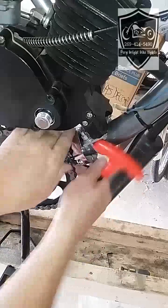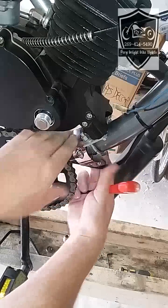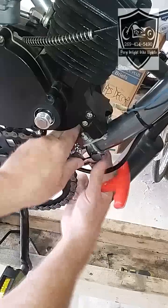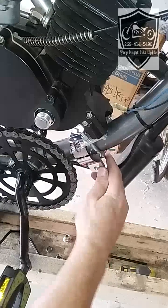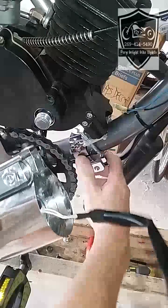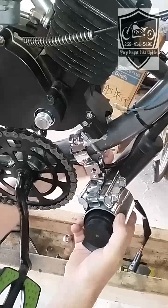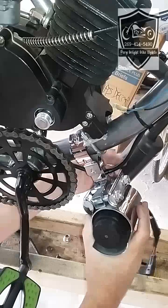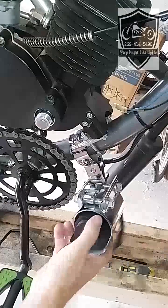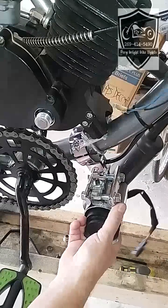That's kind of snug, and I know because this bike already had a charging system on it and I took it off and I'm putting it back on to make this video, so mine's going to mount right here. I'm just going to leave these as they are — it's snug enough to stay in place. Now we want to mount the alternator. I can wiggle this around to get it a little bit easier to get to. Make sure these are lined up so I can put my bolt through from the other side and screw it in. I'll leave this finger-tight until I'm ready to do final adjustments. That will go like that — just barely clears my pipe, but it does clear, and baby clearance is clearance.